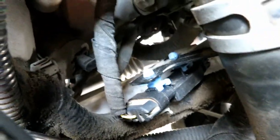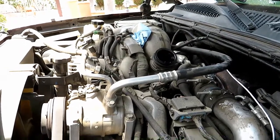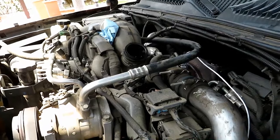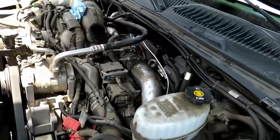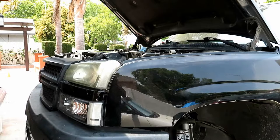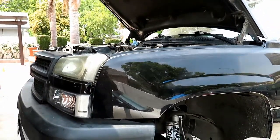We're all plugged in. Normally you would put the intake resonator back on, but I've got thermostats to change. But if you're just doing the vane position sensor, put the resonator back on, clear your code and hopefully you're good to go. So that's how you change your vane positioning sensor on the LBZ Silverado. Hopefully this video helps you all. Have a good one.